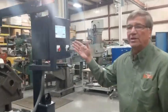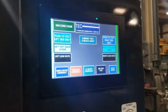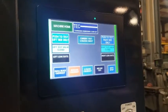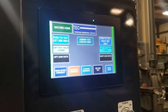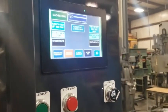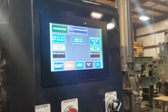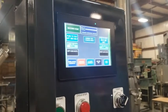Let's take a look at the screen here real quick, and then we'll show you the test. This is set up to test a small block Chevy, big block Chevy, and LS block Chevrolet. When you get a casting, you don't want to build the engine just to find out that your casting leaks. After machining, you can put it on the test stand, and in five minutes you've got your results.